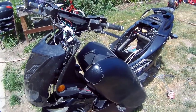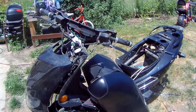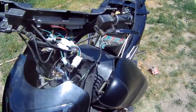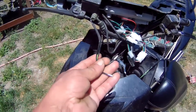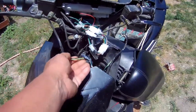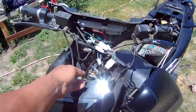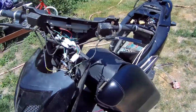This thing — I went to my favorite store the other day and it just stopped on me. The motor just gave out for some reason, so I had to take this apart. I had to take quite a bit apart just to get at the wires for the brake levers, to make sure I disconnected them — because it has an accelerator cutoff switch. Every time you press the brakes the accelerator cuts off, so if those switches are defective the bike will not go. I disconnected both sides and that wasn't the problem.